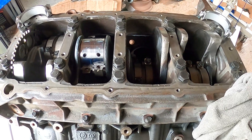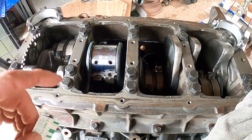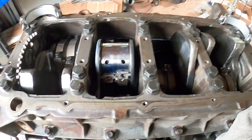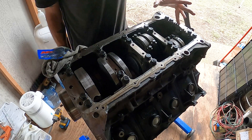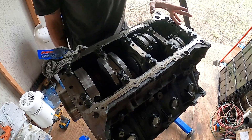I'm going to rotate the engine, bring all the bolts back out, blow out the holes, put some ARP assembly lube on them, and re-torque them down. Side note: this timing wheel right here — you do not want to damage any of the teeth on it, because if you do, you might as well just throw your crankshaft away.